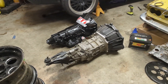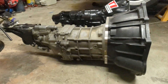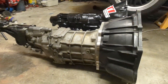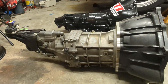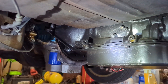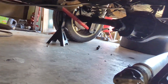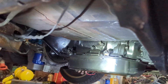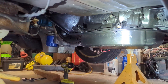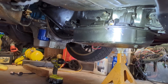There it is - there's the AR5. This is a Pontiac Solstice AR5 - it's a good transmission, just not stout enough for what we need to do. I mean physically it looks stouter than the Turbo 400 but they're actually the same length, so that's kind of cool. Here's where we are on the LeMans: the Turbo 400 is in, my buddy Justin came over and helped me put it in. I need to jack the rear end up, put it on jack stands so I can measure for a driveshaft, and I'm waiting on cooler lines. Other than that, put the shifter in and it's basically ready to go - that'll be another video. Hope you guys enjoy this, No Name Nationals 2023, let's get this done!